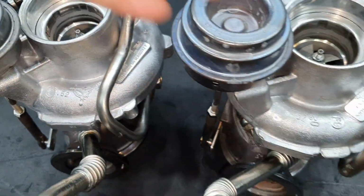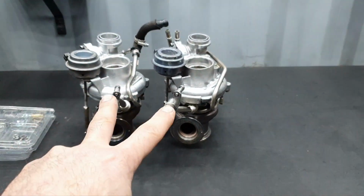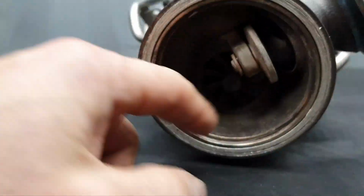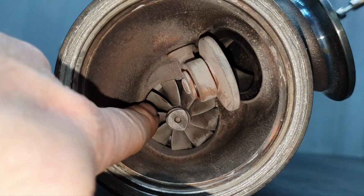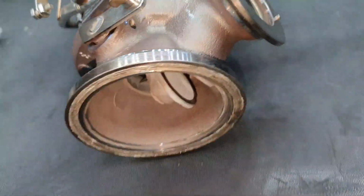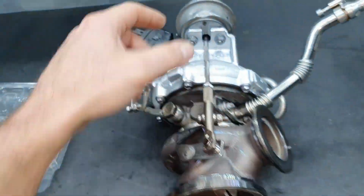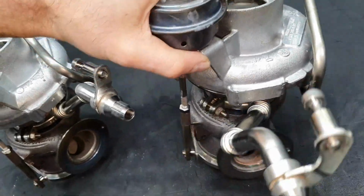It's not the ball bearing, alright, obviously, you saw it. So now, I'm going to give it to Mr. Nufu to install them. What is he going to do? He's going to start the car. Like I said, it will slightly start smoking at the beginning, because of the lubrication that is back here, when I insert inside, the same thing also from this one. I think I put a little bit more. Yeah, you see it's wet. The turbine wheel is wet. Alright, so it's going to start smoking at the beginning. When it comes to operating temperature, it should stop smoking.